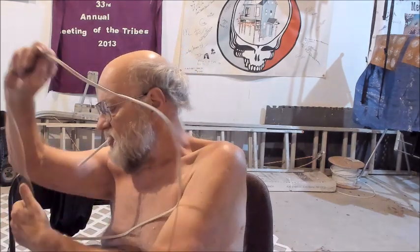The first thing I looked at was the cord. It says that this device has some sort of protection. Down here at the end of this white section there was a tag, and it said this cord is protected some way. Sometimes these power cords have a built-in fuse right in the plug at the end. I looked at that, and there was no fuse in there.